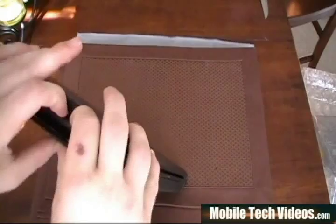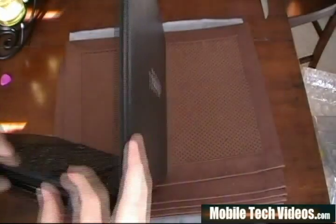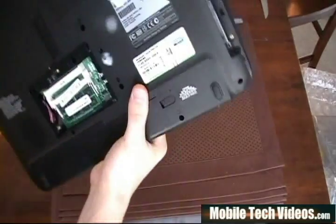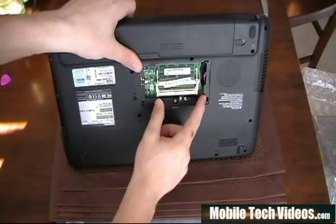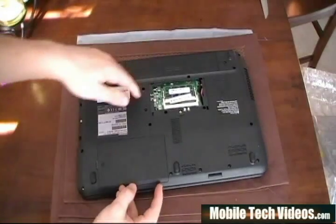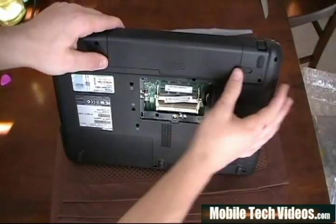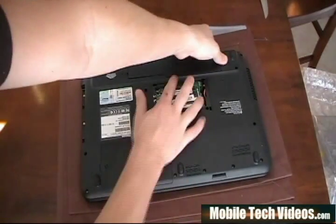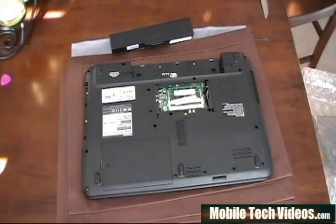Except for this last piece, which we will get momentarily. Double check everything — there's that last piece, we've popped that back on. That'll come back down once we insert our screws. Now we want to install all the F6 screws — there are 14 on the outer perimeter, and two here under the memory screen. Then we'll reinstall the memory screen. Before we put the CD-ROM back in, put in the F2 screws that were here and here, as well as the F2s that were underneath the battery, which are there and there on the brass locations. Once you get all that back together, we'll do one final test and then we'll be done.